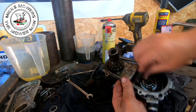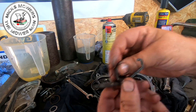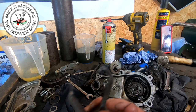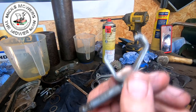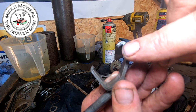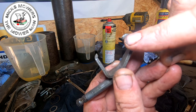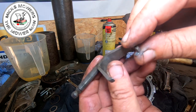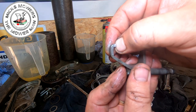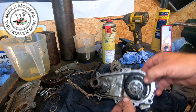So my clutch fork itself is absolutely knackered, because you can see here on this end, let me turn that light on so you might get a better view on it. So on here, you can see I've got a little tiny niblet, but look how thin it is. Look, it's worn away. And then that bit there should be as long as that side there also, so it should have a bit inside. So my clutch fork's actually gone as well. So I have diagnosed the machine right. It wasn't just a clutch, it was actually the clutch fork as well. So that's that.